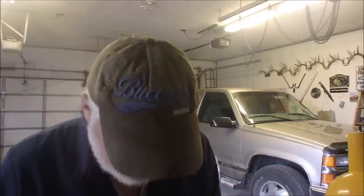All right, I'm looking up the head torquing specifications, and it says 200 inch pounds. Now in the actual chart, it says 160 to 200 inch pounds, but I'm going to take it all the way to 200 inch pounds, not foot pounds, because it's an older machine, and there might be slight variations that weren't there 23 years ago. Is that better? So yeah, I'm going to 200 inch pounds on this head. I'm going to clean it up first, and we'll come back.